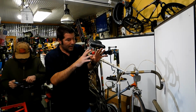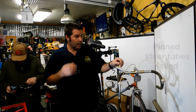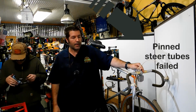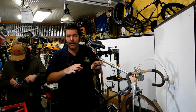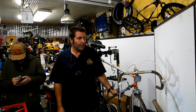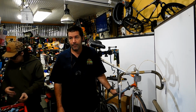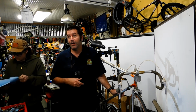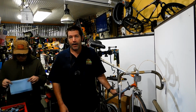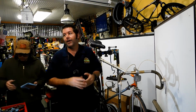We'll cover that, but on this bike right here, they made a cast aluminum fork that tapers down to the bottom, and then it swoops out to allow for some flex to make the ride smoother. Well, I don't know what the engineers were thinking, because aluminum doesn't like to flex over and over again. In fact, aluminum hates it, and aluminum breaks. There were no known deaths from this fork, but there were many injuries. People would be riding along and all of a sudden, tink, and next thing they know, they're waking up in the hospital because their face has made contact with the concrete.